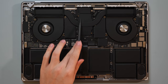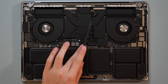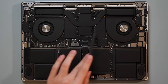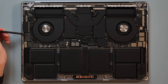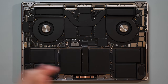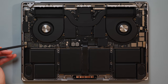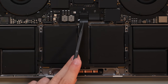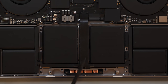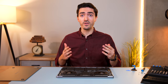Right down here we have the M1 Pro. This is a long SoC package — you can see there's quite a bit of heat sink and a pretty beefy heat pipe going to both sides. This particular computer has the one terabyte SSD. You can see the flash storage over here, but these other pads look empty — they're probably populated if you go for the larger storage tiers. You can also see the ribbon cable for the Force Touch trackpad, which means it's still replaceable without taking the battery out.